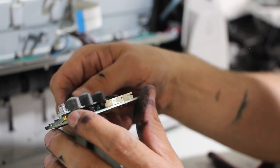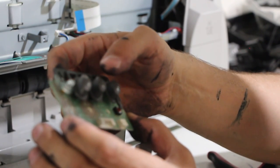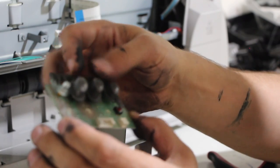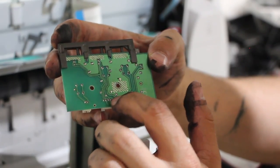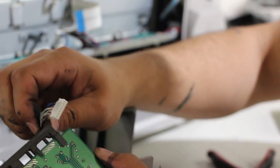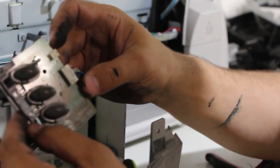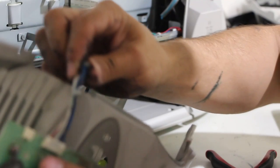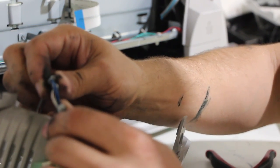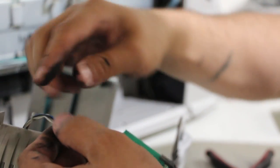But if you're working with the Arduino and you're in a pinch or you just need to get some and save some money, there you go. You can make yourself a small project right here. In fact, if you trail back, you don't have to take the switches out at all. You can look at the back of these traces and figure out where the connections are to here, and then from there, right, you've got the cable. I said don't cut it. You could connect this back, and now you have switches that you could use for your Arduino. And instead of messing with all four wires, and they're very small, go to the other end of this, wherever this trails off to, and connect that to the Arduino. Connect this to your pin 13 and pin 12 and your ground and VCC, whatever you need to do with it. So that's why I was saying keep the cable. So we're gonna keep this, keep the cables.